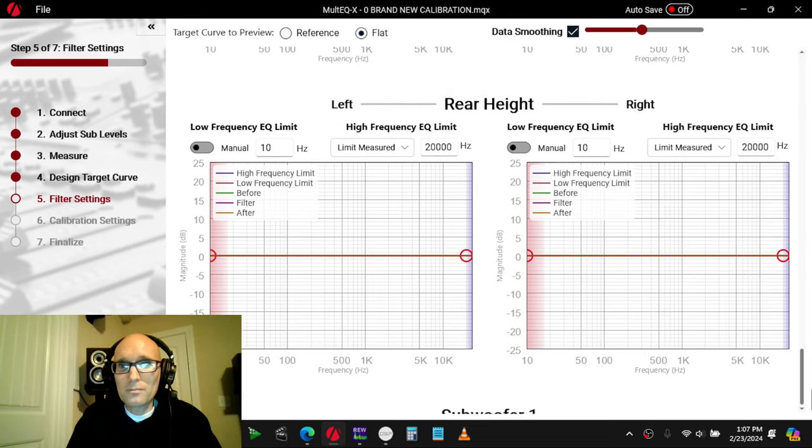It's good. I like to calibrate my subs at 86, 85 dB. 75 dB is too low, I've found. There's not enough energy from the speaker. So pretty interesting. Again, it's 10 dB louder than the mains, which is what it should be. I like 86 because when you only measure one speaker, it should be 80, because there should be a 6 dB increase. So all right, everything's set up. That's how we set things up.